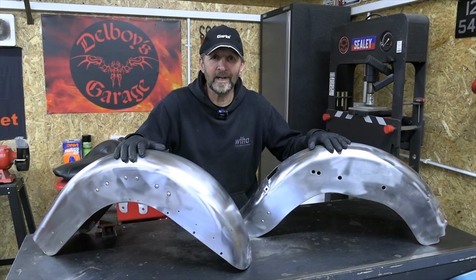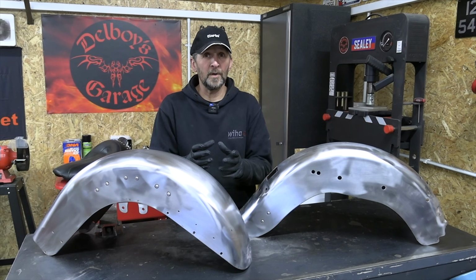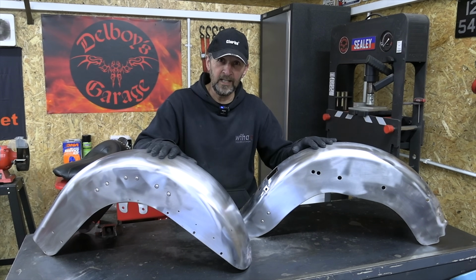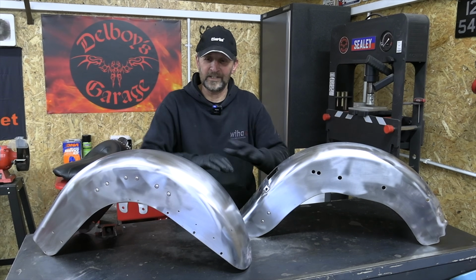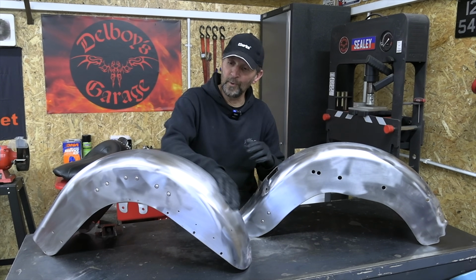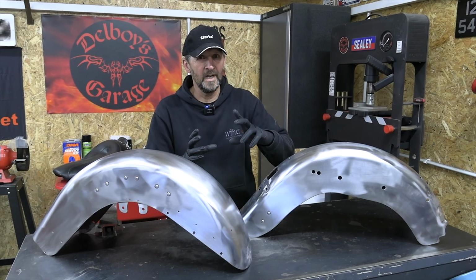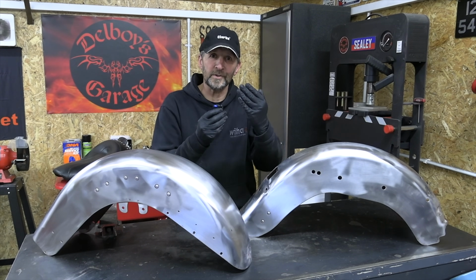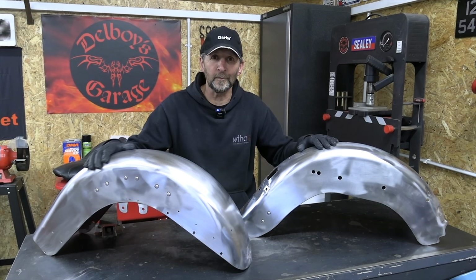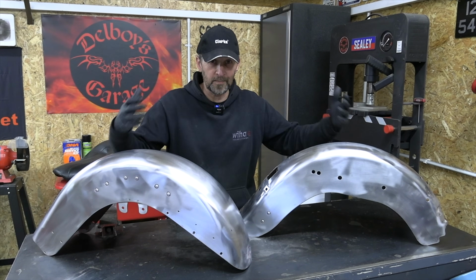There, 2.5 hours later, shiny bare steel and absolutely chuffed with the results. It's a 3-stage process. Use these big 8-inch industrial flap discs. You start off with a 180, that takes the basic coat of paint off, that just breaks it all down so there's just a primer left. Then a 320 disc, that makes it nice and smooth, takes out all the scratch marks that the 180 left. Then you go over to a Scotch disc. It's a flap disc basically made of bits of Scotch-Brite, quite coarse, but it's enough to take everything off down to a shiny steel finish, but leave enough of an etch for the 2-pack sealer to grip hold of, which is what comes next.